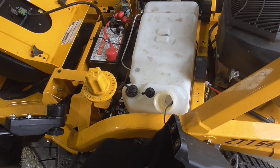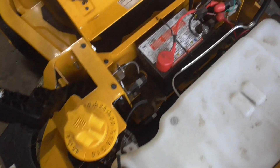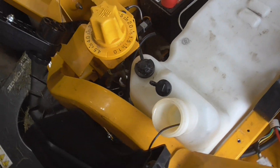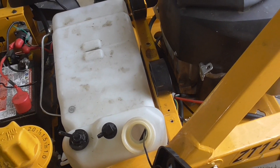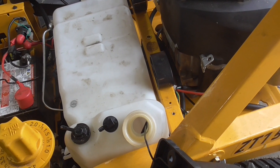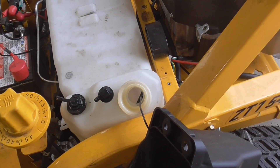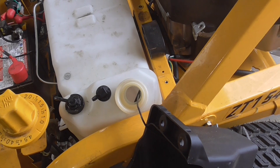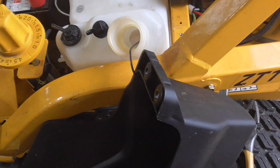I don't think the guy is putting them in there, so they must be getting sucked in. If you notice, this mower has a lot of grass buildup and sediment that blows up in there — that's kind of normal. The tank was halfway full and I poured the gas through a coffee filter, and it had so much debris in there that it seems like it's definitely getting in somehow.